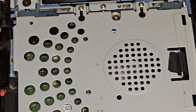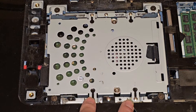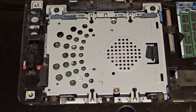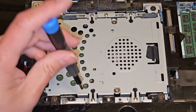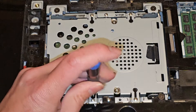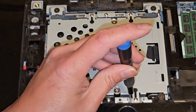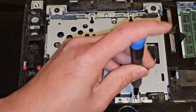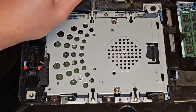Hard drive now. So we've got two screws here and two screws up here. Let's go ahead and remove them. I think I might have to switch to a smaller screwdriver — let me go get the bits. Alright, I'm back. I switched over to a PH1 or JIS-1 screwdriver. We're going to remove these two screws down here and then the two screws on top. It looks like these screws actually stay attached to this thing, so you just undo it until it kind of stops.